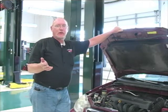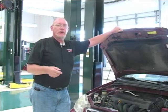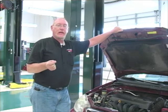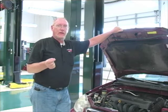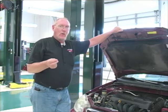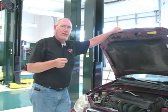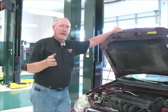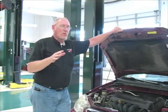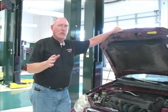I want you to inspect the customer's cooling system at least once a year, and I want you to check for two things. I want you to check the pH of the coolant — that's going to give us an idea of the health of the glycol base. And I also want you to check the mixture. We don't want the inhibitor package to be too heavy or too thin; it needs to stay roughly in that 50-50 mix that's recommended. We can go 40-60%, but nothing much more than that.